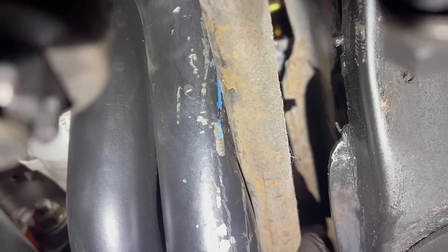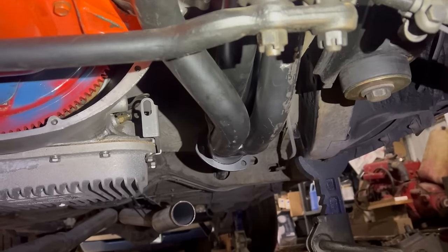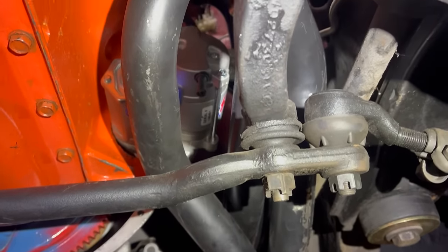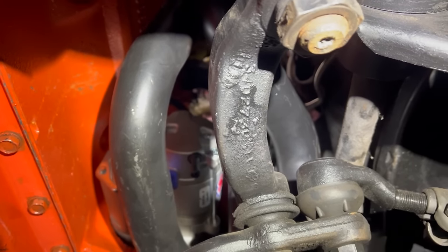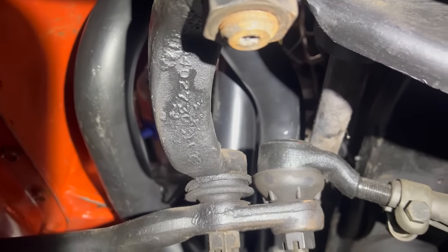I dented this outside tube to clear the torsion bar. I should have dented it more. They're not touching, but they are very, very close. Something tells me that's gonna be horrible and rattly, so I'm gonna have to work on that a bit. But the cool thing is, this header actually fits out with the engine bolted to the K-frame. With the mini starter, it's doable. I think for the old school starter, we would have had to raise the engine. Especially after denting this thing around the power steering box, it's now an easy install.